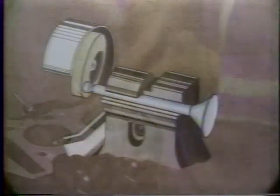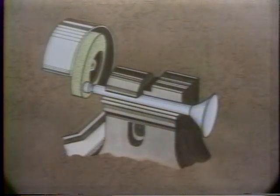When the valve or seat is only slightly damaged, or to remove dirt from the seat or valve, instead of grinding, lapping only will be sufficient. If the valve seat was ground down so much that later valve lifter clearance is found to be impossible, the valve stem will have to be ground down to increase lifter clearance.